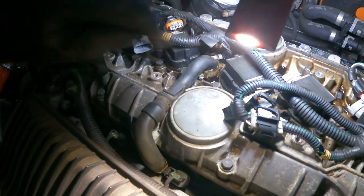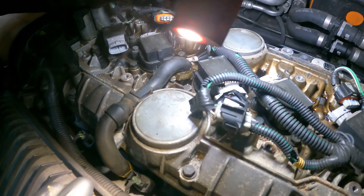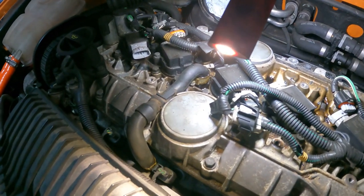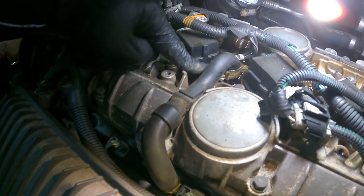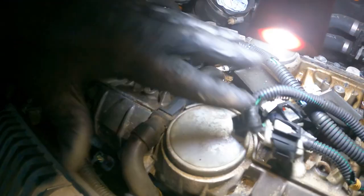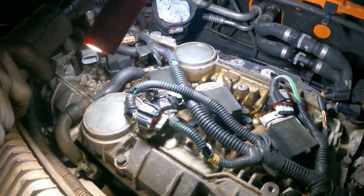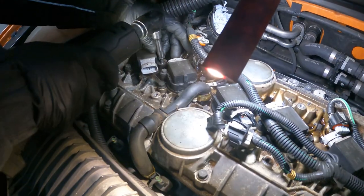But it's also got a non-standard fitting jubilee clip. When they split, it puts oil back into the head. There's a hole that comes from the top of the cylinder head — oil vapors over time turn into oil and then just gets all over. That would go back to the oil filter housing. So we need to remove the coil packs and the spark plugs because we need to do a borescope inspection of the cylinders.